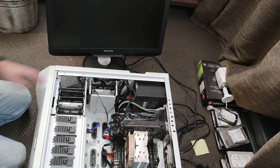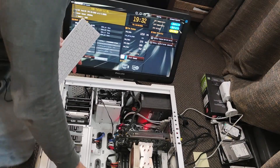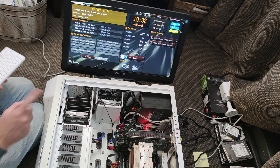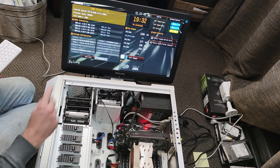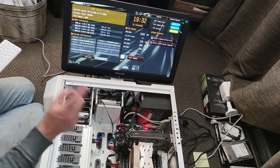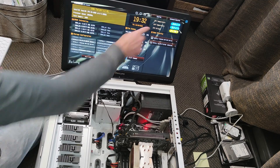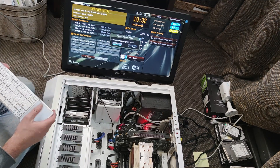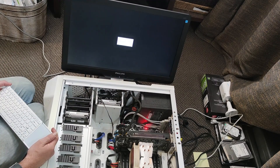Let's try again. I'm going to do some diagnosis — we'll be back later. It turns out everything was okay; it was just a faulty video cable. This is an old monitor without HDMI, and it's an old graphics card as well. I was using a DVI to HDMI adapter and something was not working. It's all going in theory — the CPU temperature is fine, which would tend to indicate that it is running. Let's discard changes and exit and see if Windows boots.